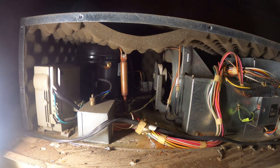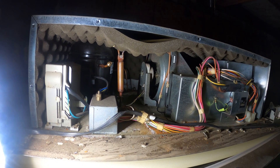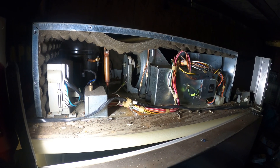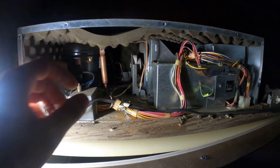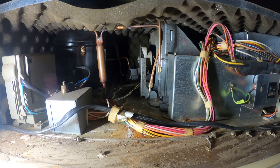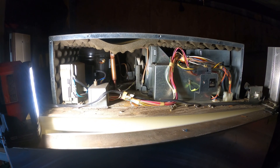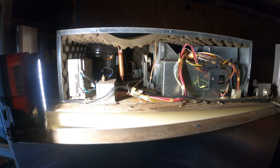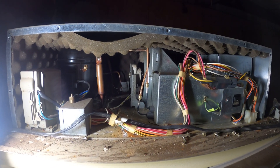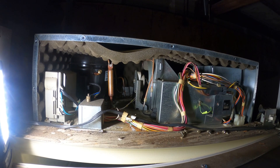We are above the unit and the condensing unit is on top, whereas typically residential refrigerators have the condensing unit below. I am the second technician here. This system has a refrigerant leak. I noticed the capillary tube — which is our expansion valve in this type of system — is broken. The last technician said there's a leak in the heat exchanger, but how did he know that when there's a huge break in the capillary tube? As soon as I pressurize this with nitrogen it's just shooting out of the cap tube. I have a feeling that's not true.